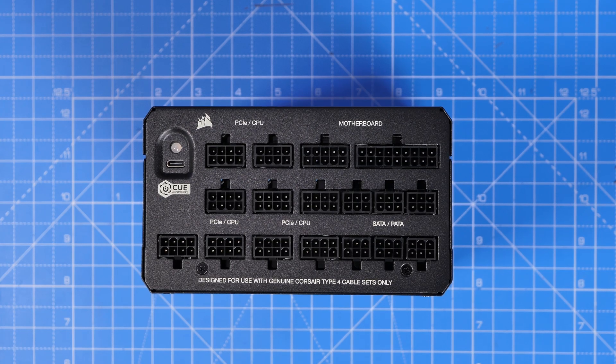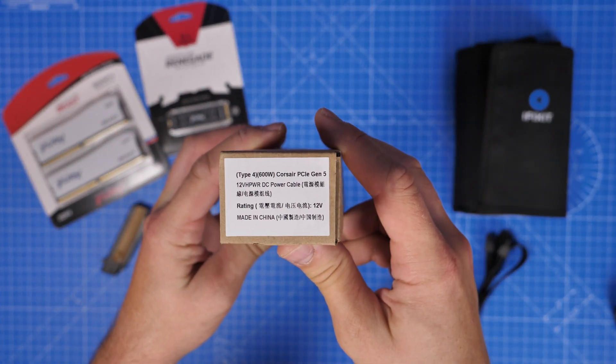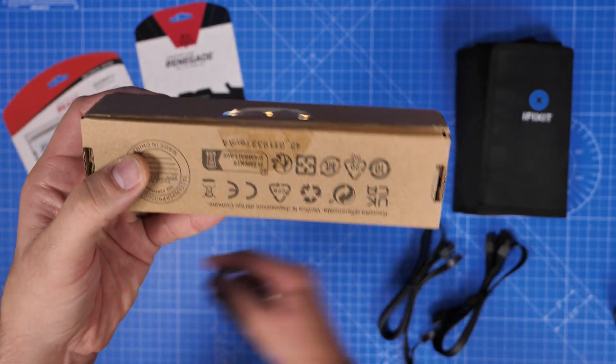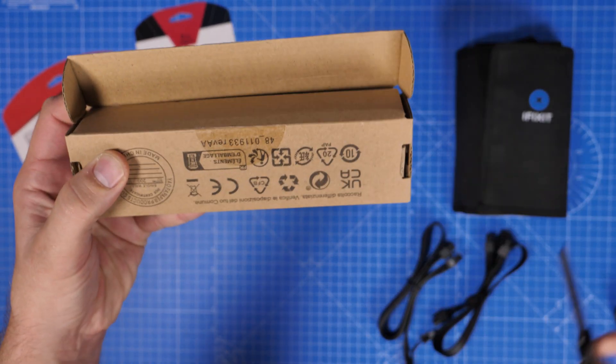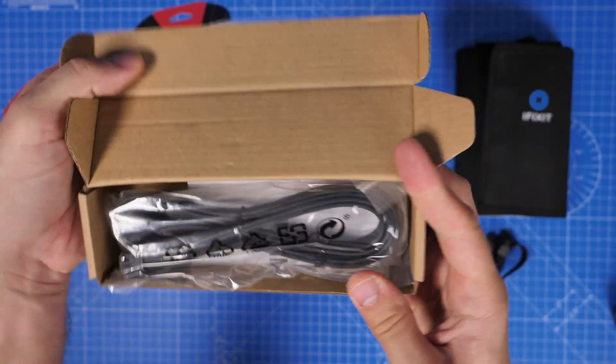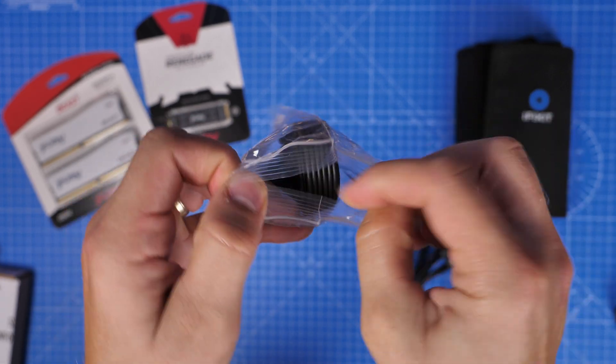One solution is to use different cables. More recent power supply units will have that option - this is a Corsair PSU I'll link to in the description - that enables you to use different power cables, and you can buy fancier ones as well. Also make sure you've got enough power; a 4090 requires quite a lot of power to run well. I'll leave that detail in the description, but run a PSU calculator with all your system specs to make sure you've got enough in your power supply unit. Whether an 850-watt PSU is enough really depends on your whole system - how many fans, how many drives, your CPU - and if you're running a high-end overclocked CPU you'll draw more power.